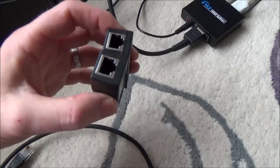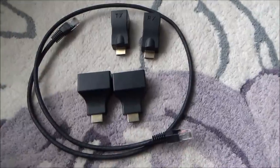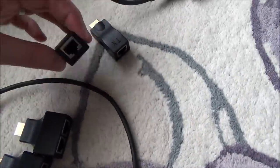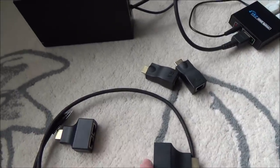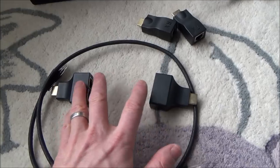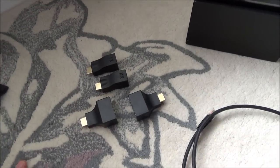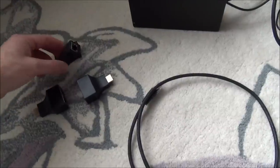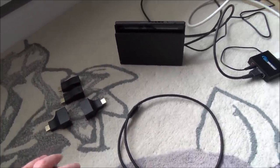I haven't had much success with the cheap ones — I could only get them to work over about 15 metres. I bought very cheap ones off eBay: one pair was about £12 and another pair was about £4. The cheaper pair requires two network cables between the adapters rather than one. If you use shielded cable it works much better. If you're willing to spend £40–£50 you can get adapters rated up to 50 metres, and apparently they do work well. The cheap ones are also supposed to be rated to 30–50 metres but I didn't achieve that, possibly due to interference in my house — so your results may vary.